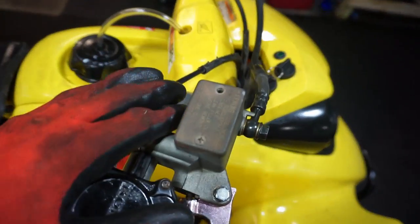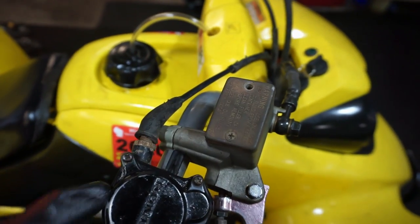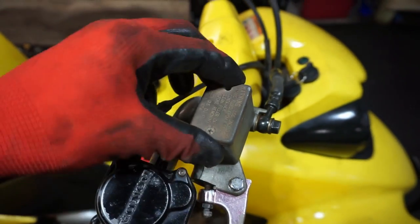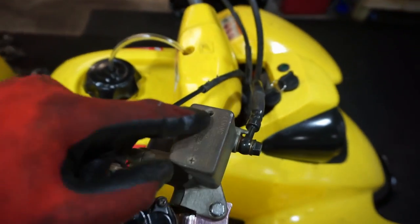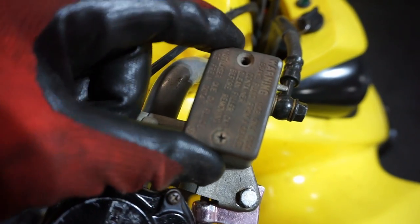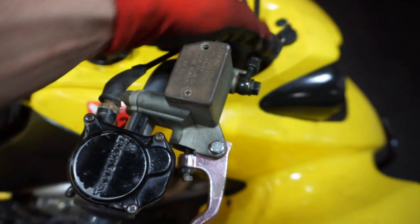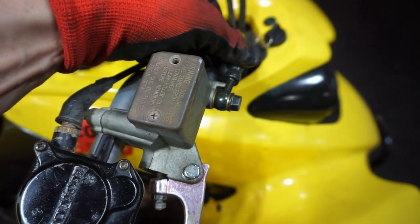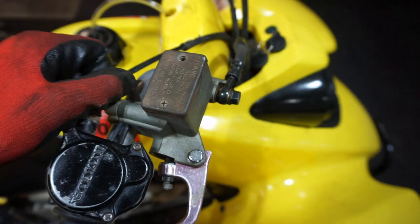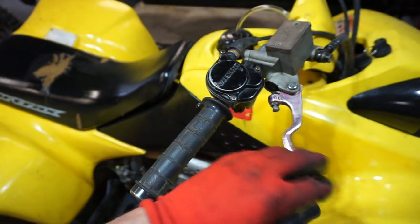All right, so none of the brakes work. I found a cap to use in my parts bin with the correct screw, so that was awesome. That one we might have to tap into. It's cut off, that bolt right down in there, so that's stripped out. Maybe I'll tap into it and try to extract that, but oh, that's loose too. We're going to try to bleed these brakes next and try to get the front ones to work at least. It might have a different lever too.